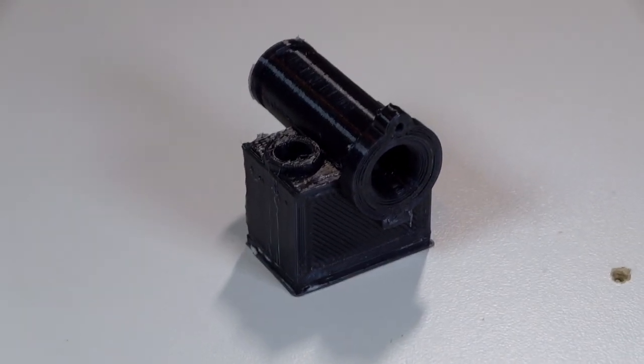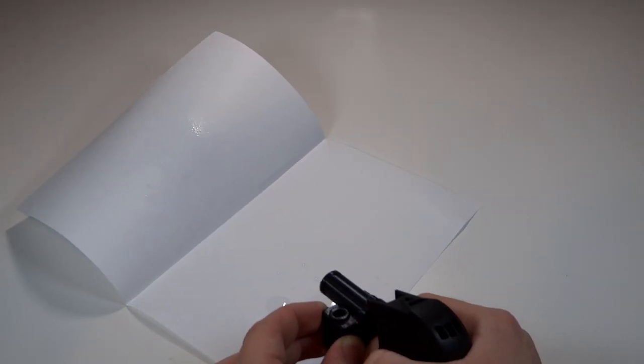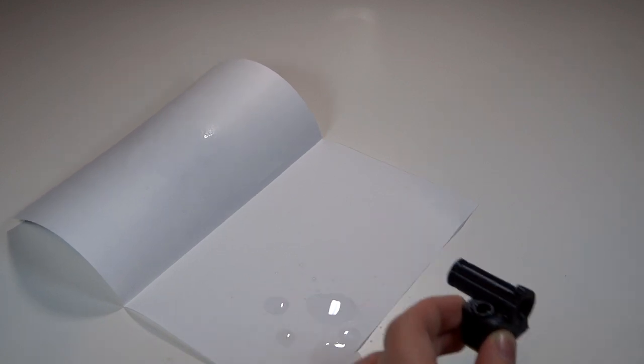This is one I had made before I did the experiment, when I was still under the apprehension that nylon was the best to use. You can see when I blow some air through it, it does pick up the water and carries it out. However, most of the water just pooled at the bottom. The problem lies in the diameter of the Venturi — the smaller the Venturi, the more fuel it will carry through.